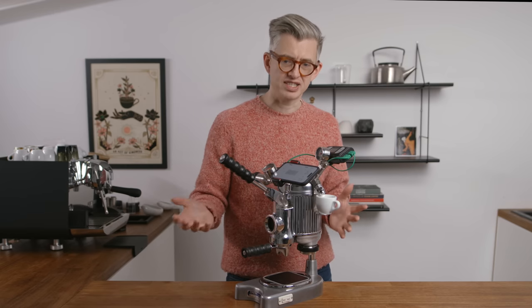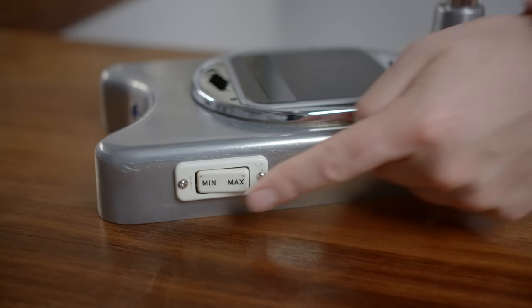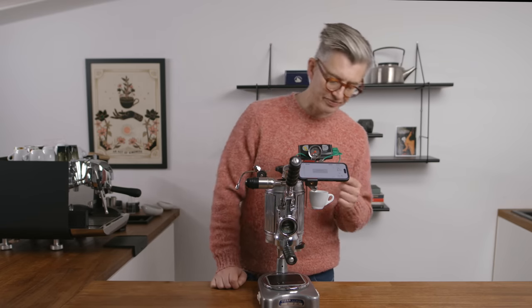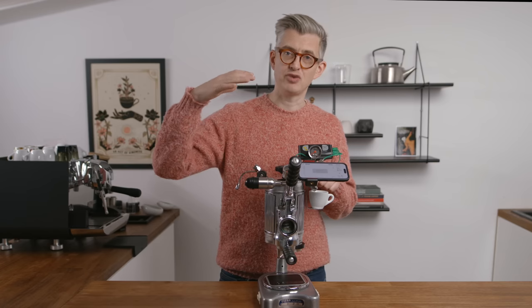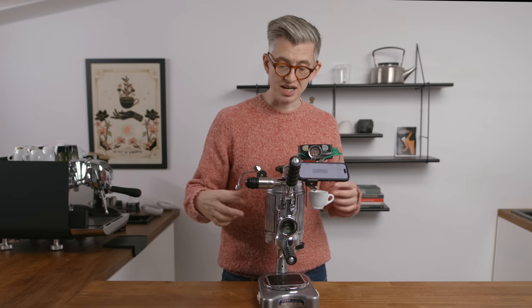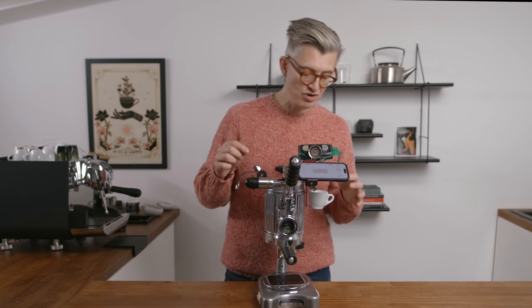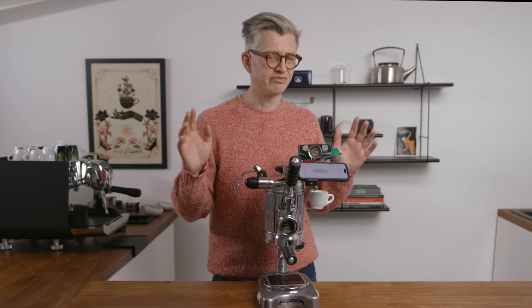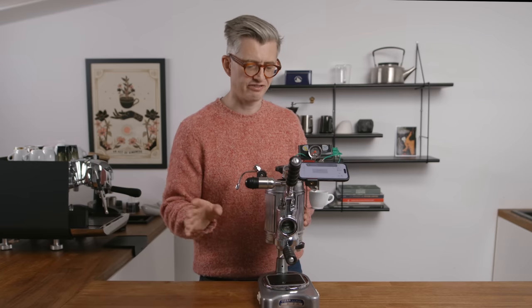To explain what I've learned, we should probably pull a shot, so I'm going to turn it on. The machine has an on/off switch on one side and two power switches — a min and a max. It has no additional temperature control from a thermostat. What it does have is an overpressure valve, and because it has a ceiling on the pressure the boiler can reach before it releases, the boiler technically can never overheat. There's water in the tank at the back and you can see a fill level and a spring at the front.